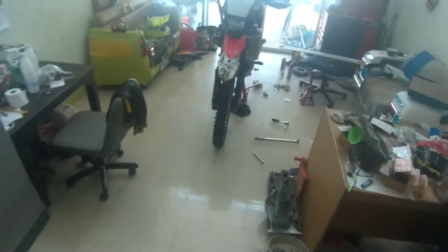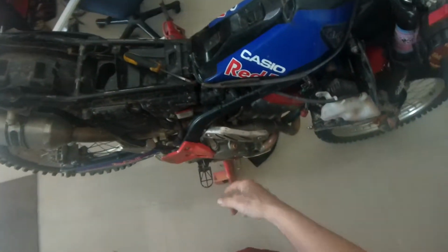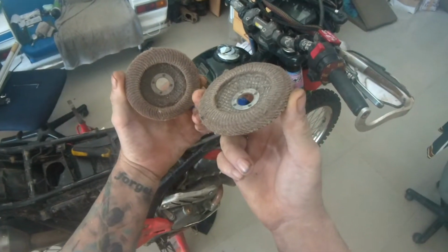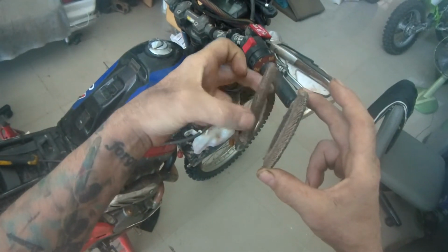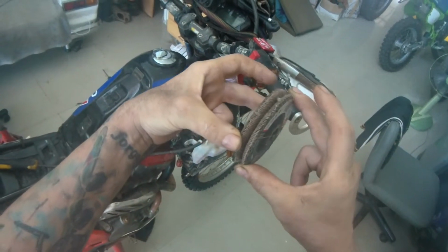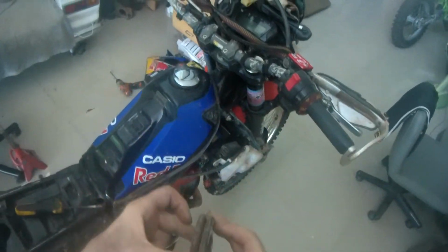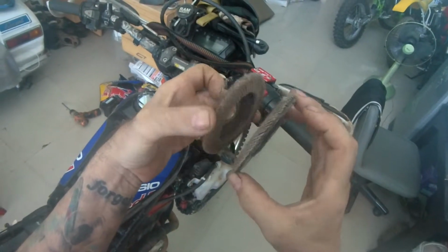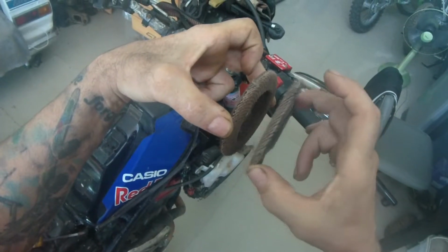Basically, a clutch is a way of disconnecting the engine from the gearbox. So if you imagine that is your engine and that is your gearbox, your engine, all the time it's running, is spinning, and your gearbox is not spinning until it's locked to the engine. Now, what you do with that lever over there is you pull the clutch away from the engine, so that one can still turn because it's the engine, and the gearbox stops turning.